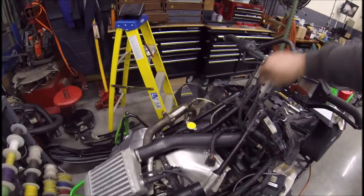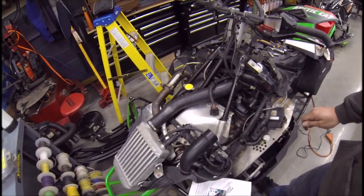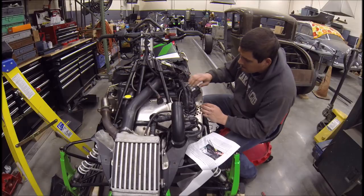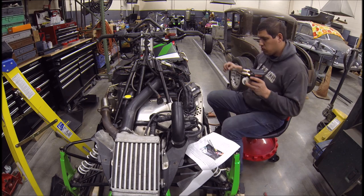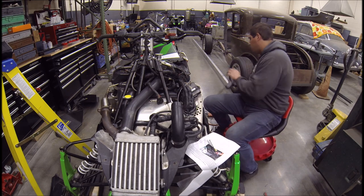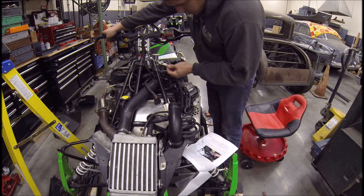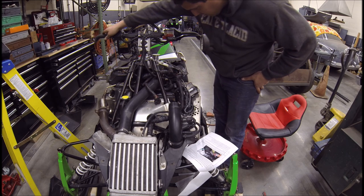This still works — I checked it. Got all the wiring tucked up with zip ties. Now we've got to connect the wire from the anti-lag switch to the one wire here. That's done. We'll heat shrink it, and it looks like the final thing we've got to do is find a spot for this ground, and other than that I think we're pretty much done.